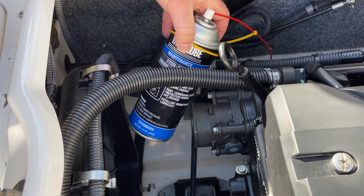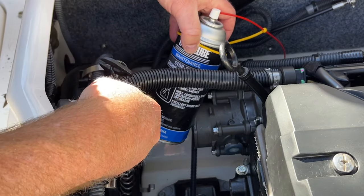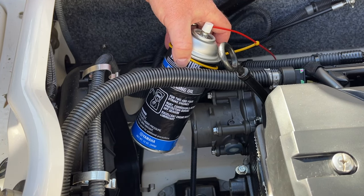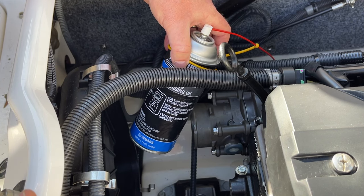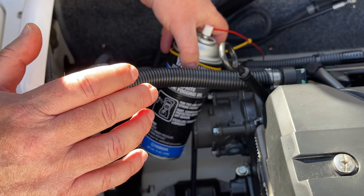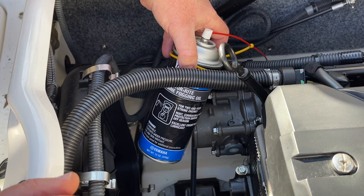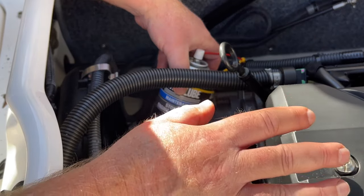So yeah, it's a good idea. You want to kill the engine, right? You've got the lanyard here, it's just so easy to pull the lanyard. So you want to kill the engine, pull that lanyard, and do that when the fogging oil is really in there good. Of course, you should have the water turned off immediately before that, so that the water doesn't continue running with the engine off. But that's pretty much the best approach to apply this fogging oil at that high RPM. Leave it in there, let the engine die with a whole bunch of it shot in there in the last few moments. Now we can move on to phase two, which is introducing the fogging oil into the combustion chamber itself.